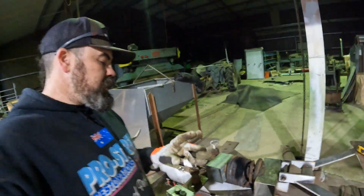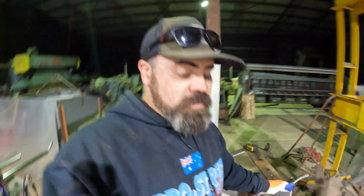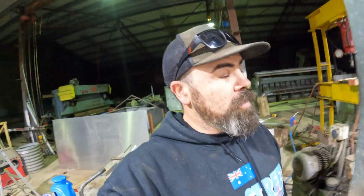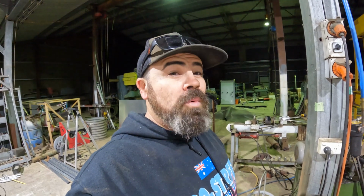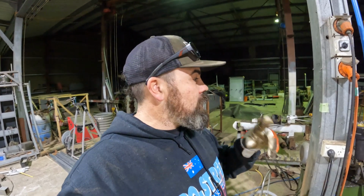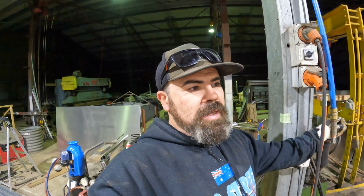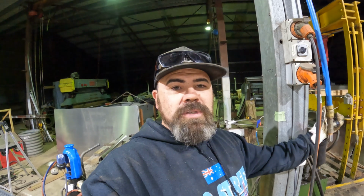All right, so what I'll do now, I've got the compressor running. I'm actually just going to cool it off with air. Don't just drench it in water. You can look up on the net the proper ways to quench spring steel. I think it might be oil, not sure, check that. But I'm just going to cool it off like this, or you can just let it cool naturally if you're sure it's in the right spot.